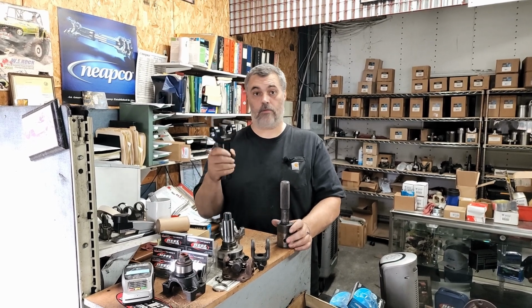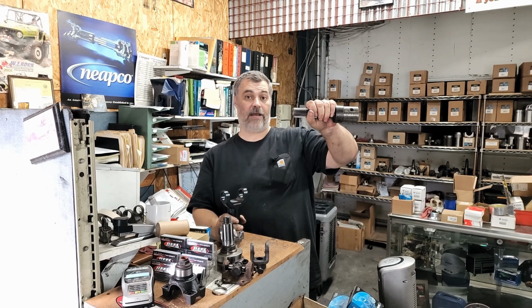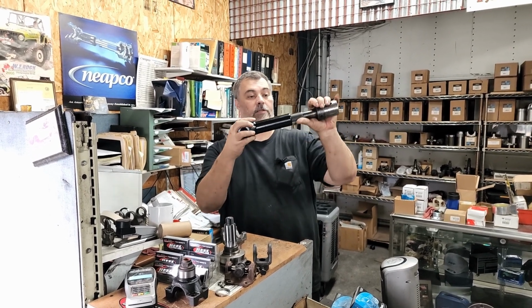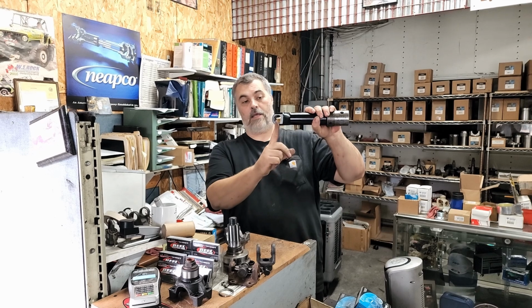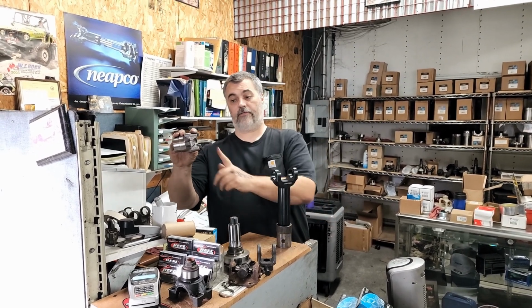So you take the transmission yoke, the part that goes into the transmission. This is basically a spline coming out of the transmission, the tail shaft. So you take your yoke, stick it into the transmission, and shove it in until it bottoms out. And you'll measure from the center of the U-joint to the center of the U-joint at the differential.